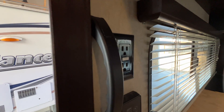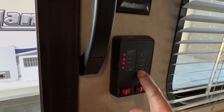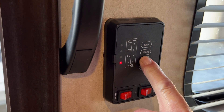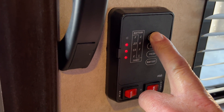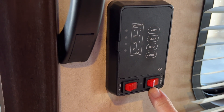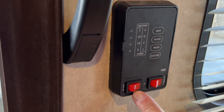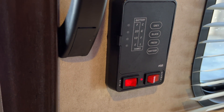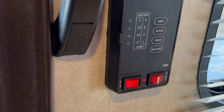It also has a 110 outlet on either side of the door. Coming down to the monitor panel — push the battery button and it shows you fully charged. To get an accurate reading on the battery, you want to have your 110 line unplugged and then push that button. The fresh water tank was filled with water and emptied; the black tank and gray tank are still full and need to be dumped. The red switch on the right-hand side turns your water pump on between the fresh water tank and the faucets. The second red button to the left turns your hot water heater on gas — a little red light in the center comes on, stays on for about a minute, then goes off and goes through three lighting processes to light the hot water heater on gas.